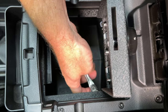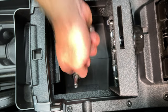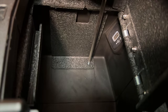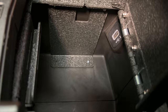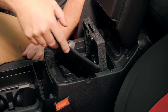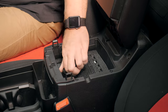Go ahead and grab the four provided acorn nuts and secure them to the welded studs on the underside of the lid. You can use the provided wrench or a small ratchet to speed up the process. Finally, we need to install four self-tapping screws through the bottom plate of the vertical support into the center console. Because this is just a plastic center console, a regular screwdriver should work just fine. With the screws installed, we can reinstall that liner in the bottom of our center console, and that completes the install of your Black Horse Off-Road Center Console Security Insert.